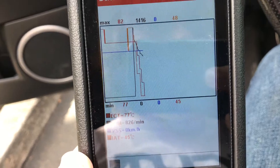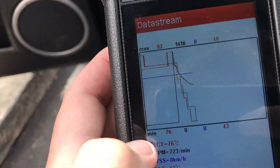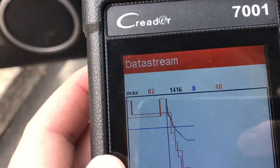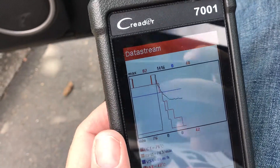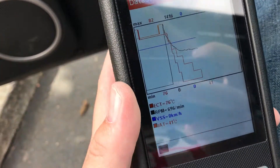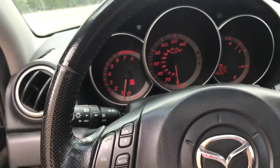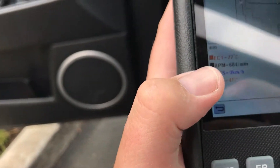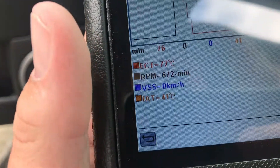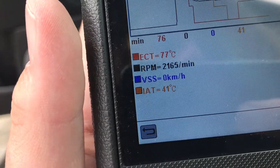As you can see here, it actually collects the data all into one graph and shows you everything going on at once. You can see when I started the car my RPM really shot up. Everything is color coded so you can compare, and it shows you the maximum values for any of these entries. Right now I'm at 710 RPM, which is below idle — it should be around 800 or so. Part of that is probably the O2 sensor and the thermostat. My car is very shaky. The check engine light was definitely warranted and you can see everything on here right as you're going.